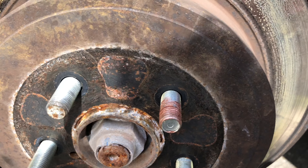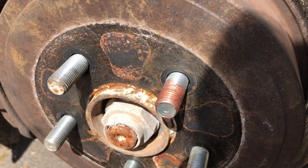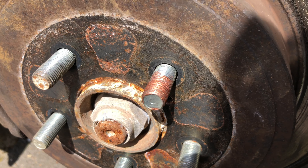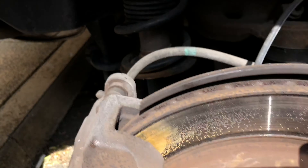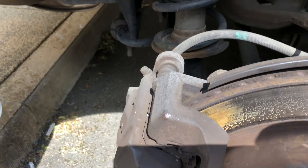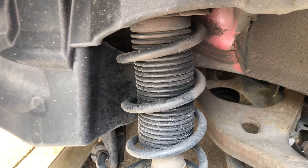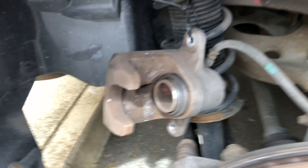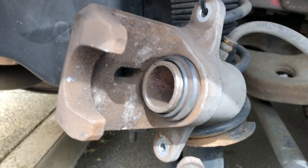As a last resort I've applied some anti-seize grease, hoping that will get the lug nut to thread back on properly later. I've just removed the caliper bolts that hold the caliper to the bracket and I'm going to remove the caliper now. I'm looking for somewhere to support its weight, so I've got cable ties here and I'm probably going to tie it to that suspension spring.